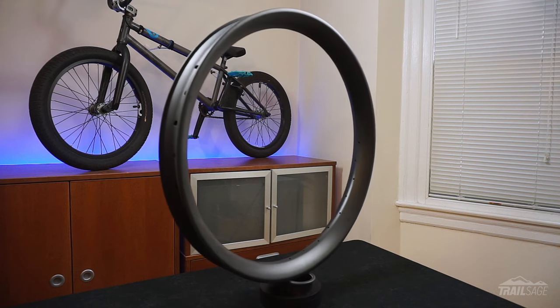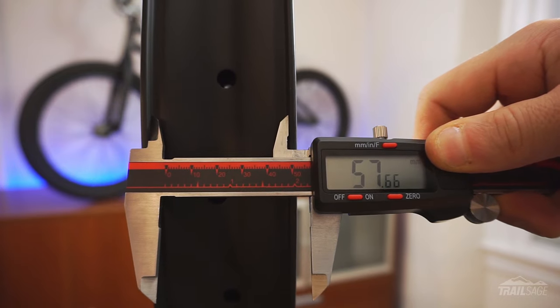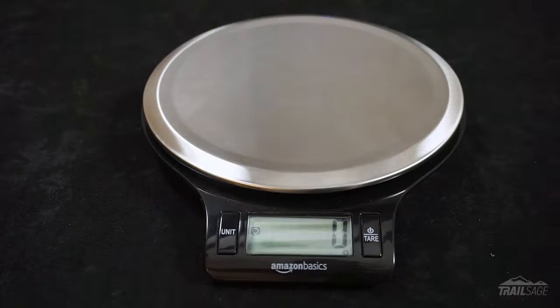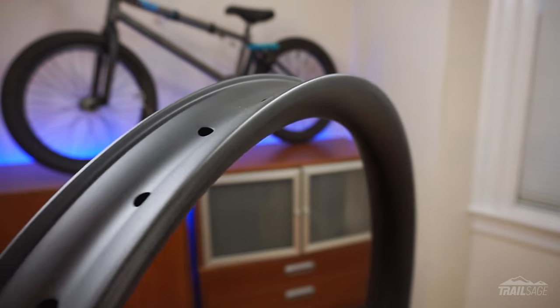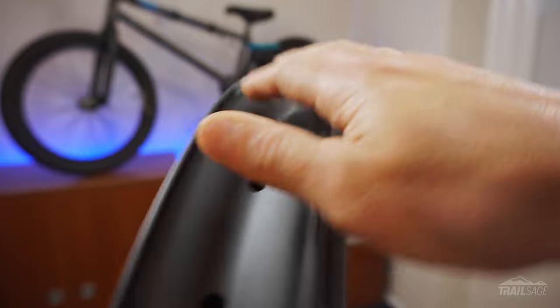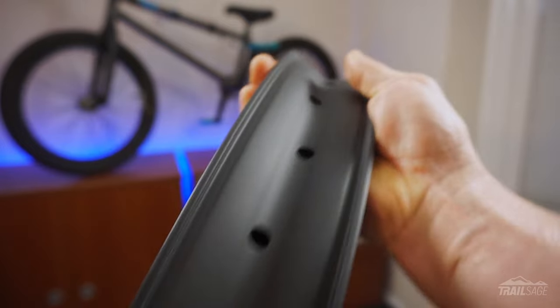Before we get into my likes and dislikes, let's go over the specs. This is a 26 inch double wall carbon rim with a 65mm outer width and a 57mm inner width. It can accommodate tires anywhere from 3 to 4.8 inches. The rims are hookless, meaning the rim edge is flat, and it can also be run tubeless. At just 553 grams, they're extremely light but that's not at the cost of safety. Aesthetically, they're V-shaped and have a depth of 34mm. The center channel is also fairly deep, which helps when removing or replacing your tires. There's no visible carbon weave on the exterior, giving it a nice clean look. I ordered this rim in a matte finish with 32 spoke holes. All NexT rims come backed with a 2-year warranty.